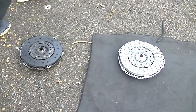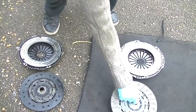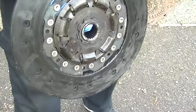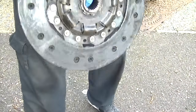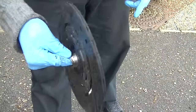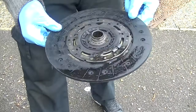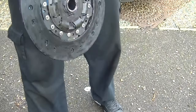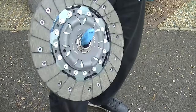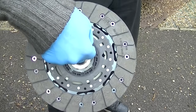These are the two clutches, and this is a good time to make sure they match up with your new one. The one on the left is my old one with that shiny greasy residue — that's brake fluid leaked onto the clutch disc, turning it into mush. There's basically nothing left of it. Clutches are not meant to look like that. In my case the clutch was slipping because of fluid contamination. Here's the new one — that's what a clutch is supposed to look like. Don't contaminate it with anything from the old one.